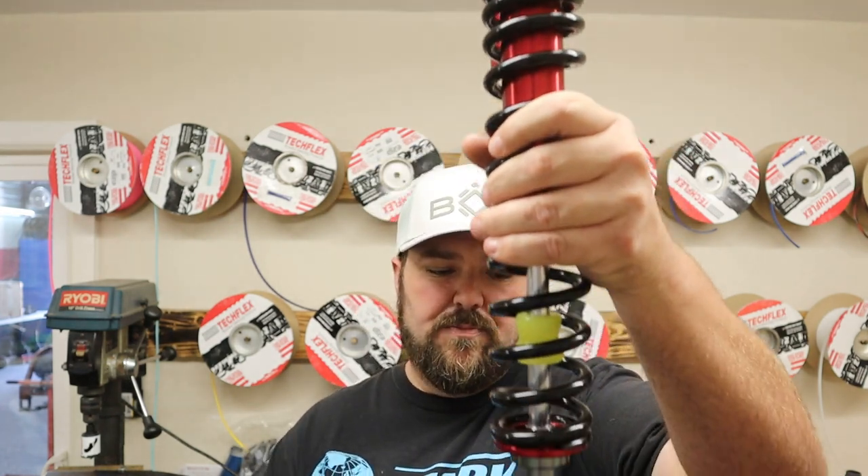There is a little aluminum spacer for the shock that goes on the Jake's long travel — that's what pitches the shock forward a little bit so it doesn't hit the A-arm. You will have to trim that because the bottom of the shock is thicker than the Jake's. I just eyeballed mine — I literally stuck mine up there with the bolt in it, put it up, and came in with a cutoff wheel.